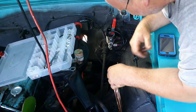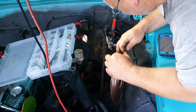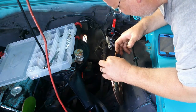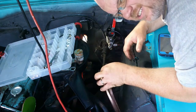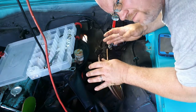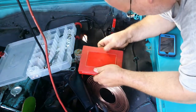So, I got to thinking about it. When I go to this setup, each reservoir is only pushing two wheels, where before with the old one it was pushing all four, so I would need a bigger line. So I thought maybe it wasn't necessary. Maybe I could use 3/16 of everything just like I do with everything else. So I looked it up and I was confirmed. Yes, the fact that I'm using a dual reservoir master cylinder and I'm splitting the brake system up, I can use 3/16 without a problem everywhere, so that saved me a trip to the parts store. And for that, I'm glad.